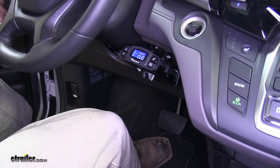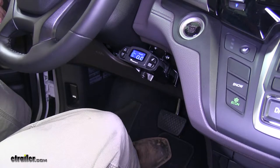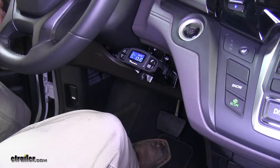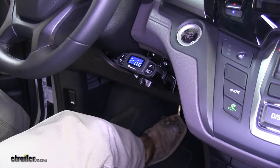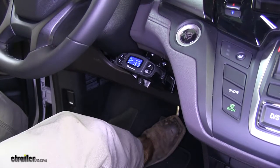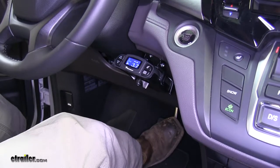One of the nice things about it being proportional is it's not going to apply the brakes when we don't need it to. So if we're sitting at a stoplight for a long period of time, it's going to save our brakes because it's not going to have them sitting at maximum power just grinding. But when we do push on the brake while stopped, our brakes are going to apply a small amount of maximum power just to make sure that trailer stays still at the stoplight.